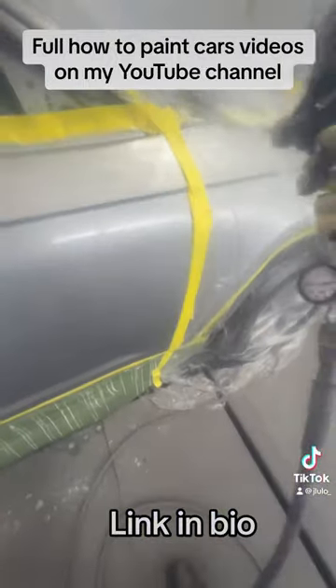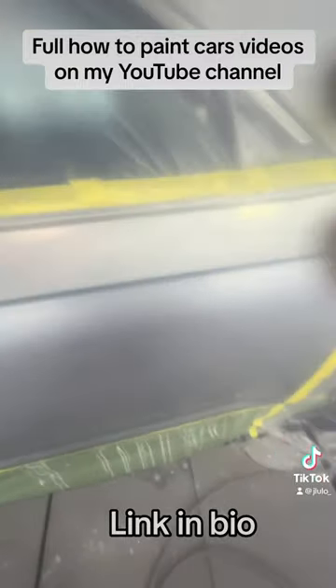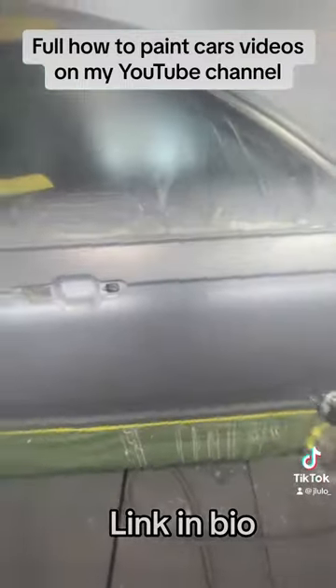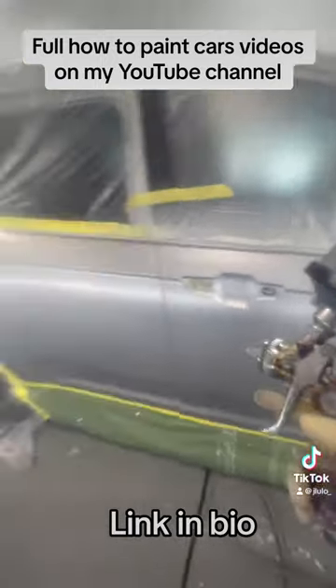This is the lifting. This in here is waterborne paint. I'm going to apply two coats of waterborne paint as a barrier to protect it from lifting again. Now the reason I'm painting it with my solvent base coat is because when I originally painted the car, this is the paint I use and it's solvent.